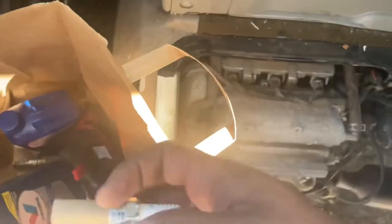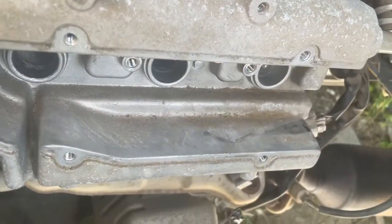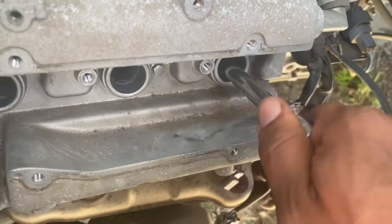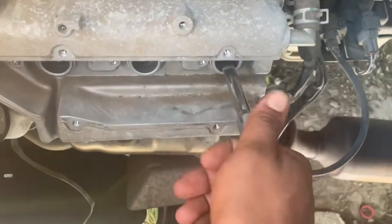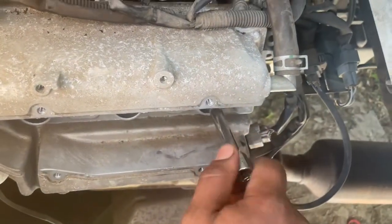See that corrosion on the plug — just going to get rid of that. Go ahead, pop open the box, take the new plug out. Just rest that right in there. Take your ratchet — you don't want to cross-thread it — so just go ahead and rest it in. Give it a nice hand tight until it's in its groove properly.